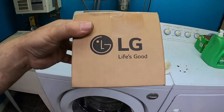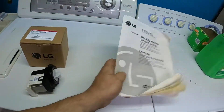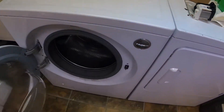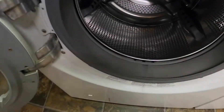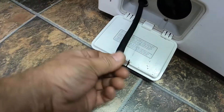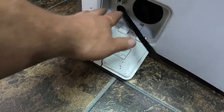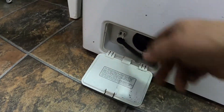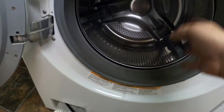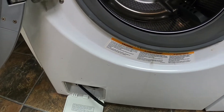So this is a genuine LG pump and we're hoping it's going to go good. To do this pump, of course, we're going to unplug it. We have to take off the front. The drum's already been drained. You can see there's a drain line here — you just pull the cap out of the end of the hose and send that to drain. That'll empty out the water. This line goes right to the pump housing and you'll be able to empty the drum out of all the water. So we'll get started on this pump.